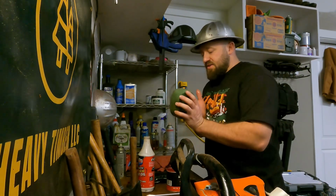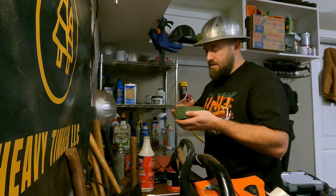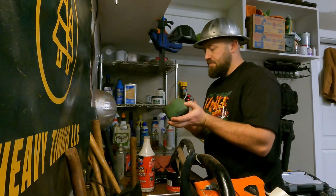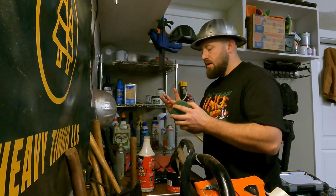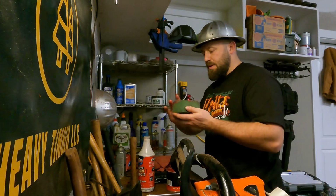And this happens on stock, the HD2 still filters, the pleated paper filters. It happens on all filters. You get fines that come through between the mating surfaces, right? So you add some grease, an extra little protective layer, and I swear this will remedy your issue.